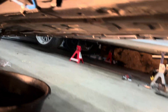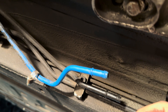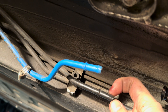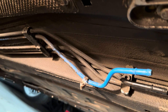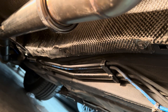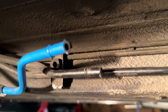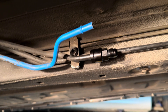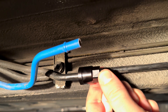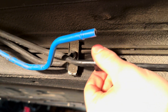This is the barbed section that flares out. I'm going to cut that off on both lines so the quick-connect fittings will slide on. If I ruin the lines I'll just go AN all the way back, but I'd rather not. The cut was a little sketchy — no sparks, these might be aluminum — but the fitting just slips on, pretty snug, and the locking ring seals it. I'll call that a win for now until I confirm it doesn't leak.